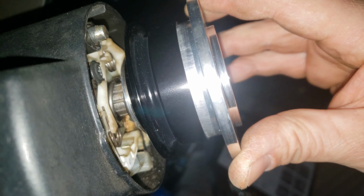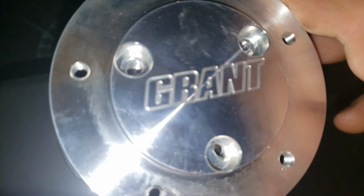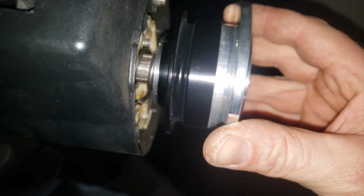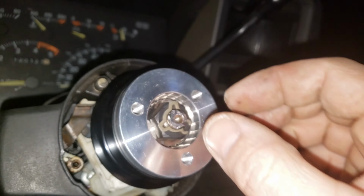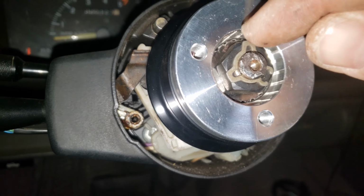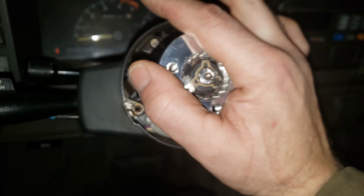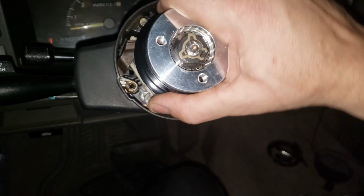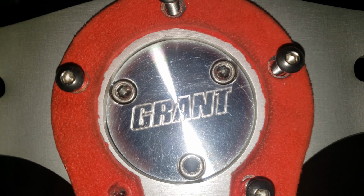So, let's see if we can get this nut all the way forward now. There's just barely room. No more teetering on the center shaft. So they don't give you much room in there. A little recess, just enough. So that might be the only option, is to back the nut off all the way up against this ring or this lock pin thingy and just roll like that for a little while. There is still some pressure on the main spring back there, so hopefully you still have a tight enough steering column. All right, another huge upset and I am done for the night.